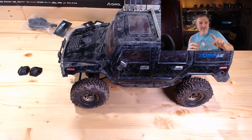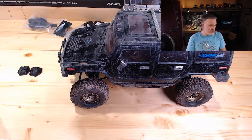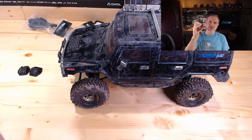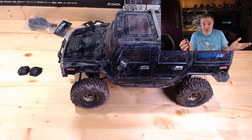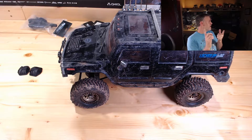The second thing we're going to do is get into the H2. A couple of weeks ago, we had this HeyOK controller in our TRX4 that I thought burned up. It may still be burned up, but I have a Castle BEC set to six volts because I realized last time we tried it on a 2S LiPo — that's not six volts. We want to try this again. If it works, we might give this away next week because it's a perfectly good controller but I've already opened it and wrote a six on it — we wouldn't want to sell it new. We will have a giveaway.